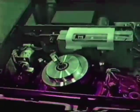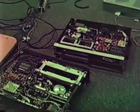Now one machine is moving at slightly different speed from the other, so tape tension has to be maintained by moving the machines apart. So now you can see the tape going in, going past where it's supposed to come off, being played by this head, and finally spooling up. So that's how it works. Those are just two VCRs.